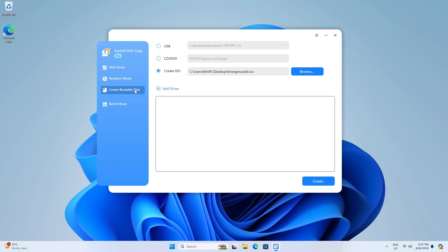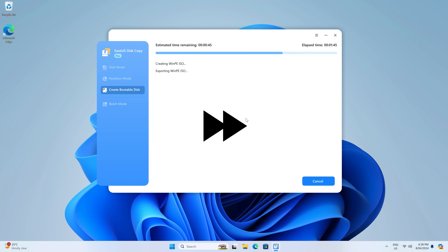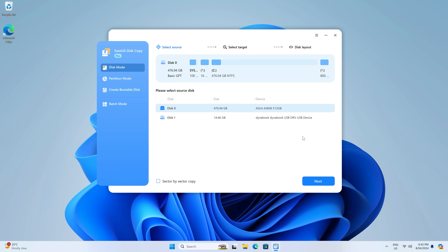Finally, you can create a bootable USB of Disk Copy or save the image for later use. Plug in a USB drive — small ones are fine, it needs less than 1GB of space — then go through the prompts to create it. Once it's done, you can boot from the USB using the PC's BIOS or boot menu. The BIOS key is usually Delete, F1, F2, or F12 when you start your PC. This is a great option for when you don't have access to Windows on the PC you're working with, or it's on a really slow mechanical hard drive that takes minutes to boot. Ain't nobody got time for that.